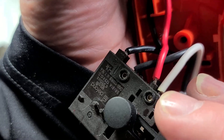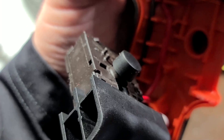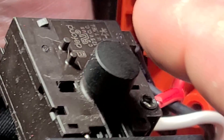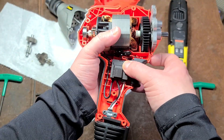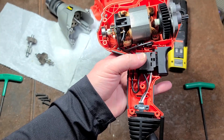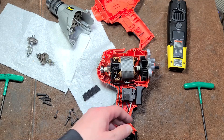The trigger is a Defond switch rated at 8 amps, 125 volts. They're saving some money there — it's a 7 amp unit and they're only having it rated at 8 amps. This is the little variable speed switch, so if you're doing heavy or variable speed operations, you do risk burning out the switch because it has very little overrating rather than being like a 10 or 12 amp switch.